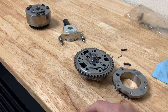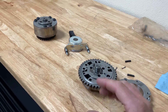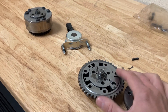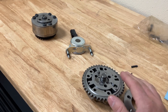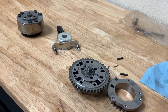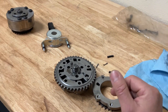So viscosity is important, pressure is important, and volume is important. Volume is critical really when you have looser clearances. Control is necessary — it's about the open pressure on the valve springs as to how much these can control, combined with viscosity and pressure. The higher the viscosity of the oil, the more valve spring it can handle. The higher the pressure, the more valve spring it can handle. The looser the bearing clearances, the less it can handle because you'll have less pressure up here. In general, a stock car with stock clearances can handle 250 pounds open pressure on the spring, no problem, and still have control at RPM. 270 is probably a bit too much, and if you have looser clearances, you may not be able to even handle 250.